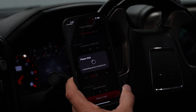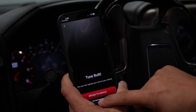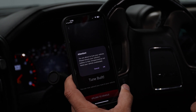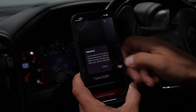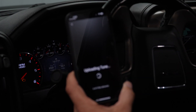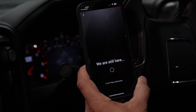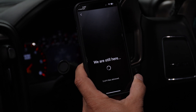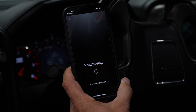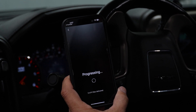Now that preloaded calibration is going to be modified to the tune we just set up. We select 'Upload to Vehicle' and get a prompt confirming we're about to tune the vehicle, reminding us to ensure the battery is fully charged and not to leave the vehicle unattended. Once we select OK, it starts uploading — working through files being delivered from the smartphone app to the OBD dongle, and then from the dongle to the vehicle's ECM. Depending on the specific vehicle and ECM, this process can take anywhere from about 2 minutes to 20 minutes.